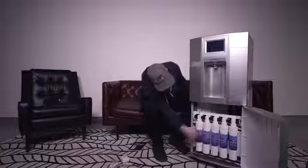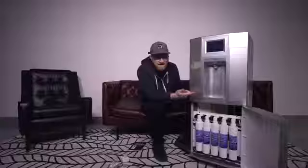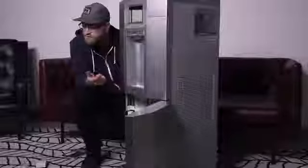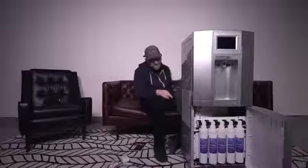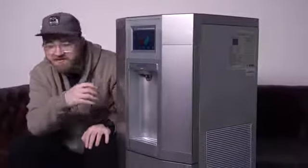These are the various filters here. That's pretty wild. These guys don't only make at-home units like this, but also industrial units that are much bigger than this. Look, it's got an air filter on it. This looks like the UV filter. Okay, so it's been roughly 48 hours since this thing was plugged in. In the early stages, what you want to do with this thing is flush it out with normal municipal water. So you fill up the back tank where the UV filter is, and it flushes through the system, at which point it begins to generate water from the air.